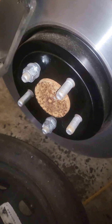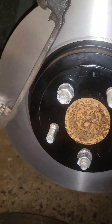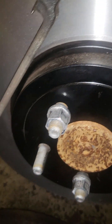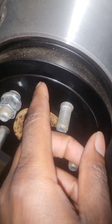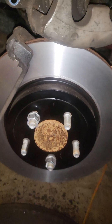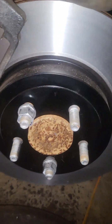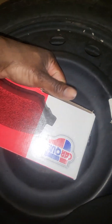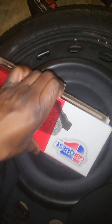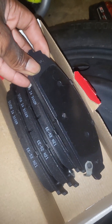Right now, this is late night — about eight at night. I'm trying to get a little stuff done. This is the rotor that was already on the car. I took it to work, sprayed that middle piece, scratched off some of the rust from the hub bearing area, painted that middle piece, and machined the rotor. It actually doesn't look that bad. I ordered pads online through Advance but got the wrong ones, so I had to go to the store and return them and get the correct pads.